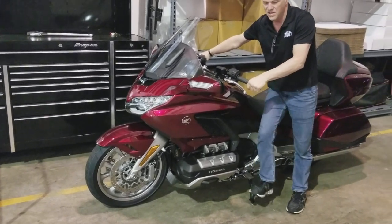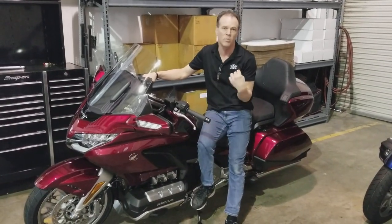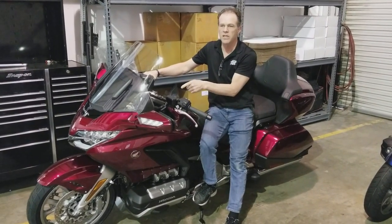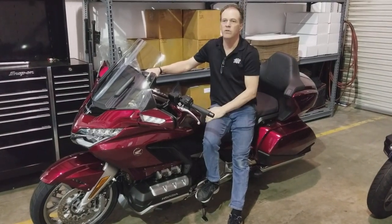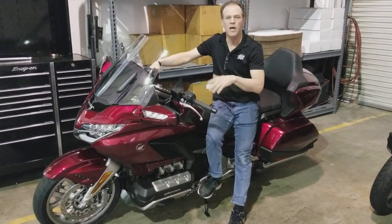So that's a classic underdamped shock absorber. That's going to lead to tire cupping that people are familiar with on the older bike. A lot of this leads to that unsettled feeling this bike has when you open the throttle or close the throttle mid-turn, or it floats a lot on the highway.